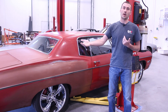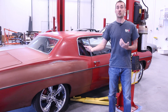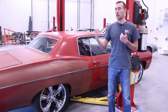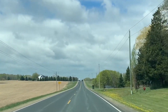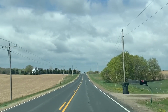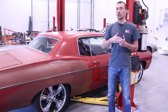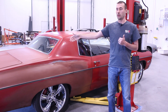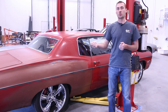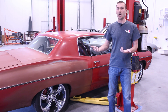When you go out to take a drive, I normally find a stretch of road that has a good couple miles with some straight-line areas, some curves for handling, some bumps for imperfections in the road, and I use that as my test road. If you take the car and drive that two-mile stretch and you have a nice safe spot to pull off, you can turn the shocks up right there in a parking lot or a safe spot.